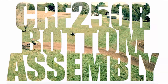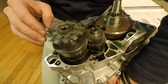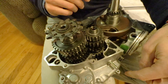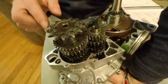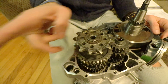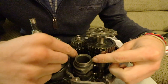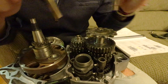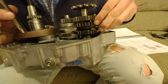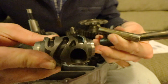First, the transmission. Here's our front sprocket, and as our power comes out of the engine it'll connect back here through the main shaft to the counter shaft — just so you know where we're talking about. The chain will go out back. Here are the shifting forks; they ride on these two rods, go into place, and pull the gears up and down. That's what actually gets pulled to spin to change gears.